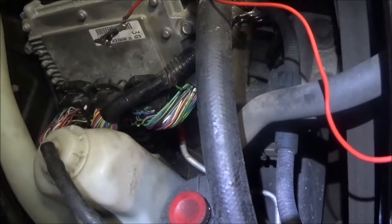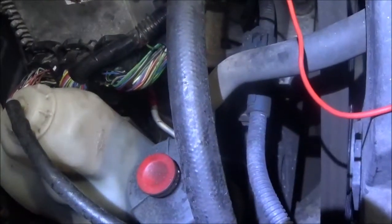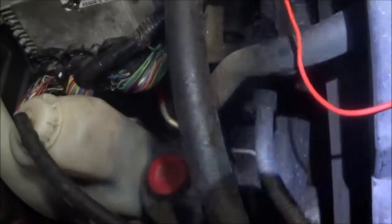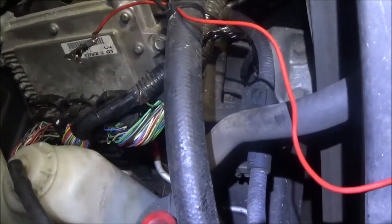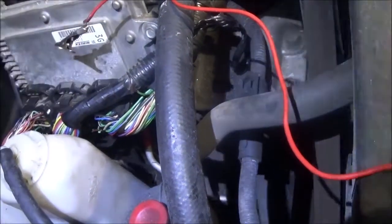Now the next thing is to test for an open. There's no short to positive and no short to ground. Now if the wire is open, it can't carry a load — you need to test it while it's loaded. So what we're going to do is load that circuit. I'm not going to load it with the solenoid — I'm just going to load it with the test light. I'll put 12 volts on one end of the wire and then touch the test light to see if it lights up. If it lights up, that means it can carry a load. A lot of times I've used a bigger light, but the test light will suffice.